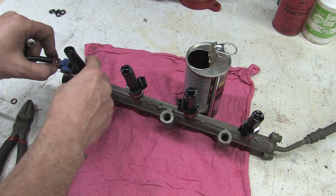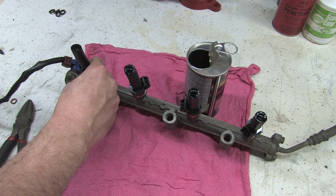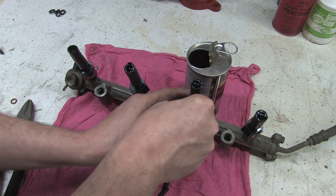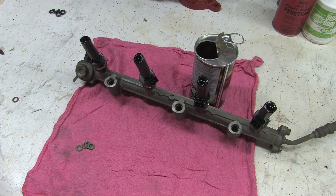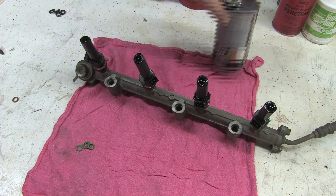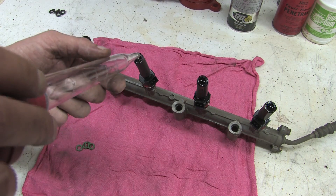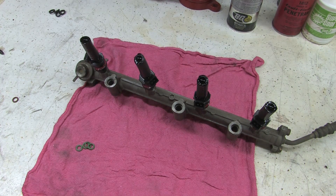One of the things I'm going to do is apply voltage to the injector to get that solution on both sides of the valves. Now, I'm going to note where the levels are. And if I come back and one of them is drained all the way down, that means it's stuck open. So this just gives me the means of checking its actual health. I'll just top this all back off.